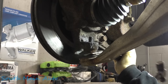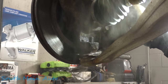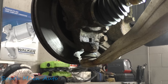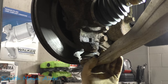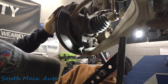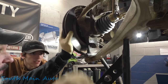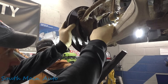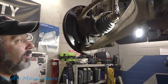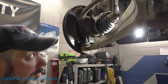Let's see if we can — oh, missed. Oh yeah, first try! We'll pull this down with the control arm tool here. There we go — catch that right there. Perfect. Go ahead and line her up. Tool back. Like I say, we don't care about this ball joint so we can let it hit the knuckle or whatever. Now we've got to work on the bolts and get the bolts out of it.